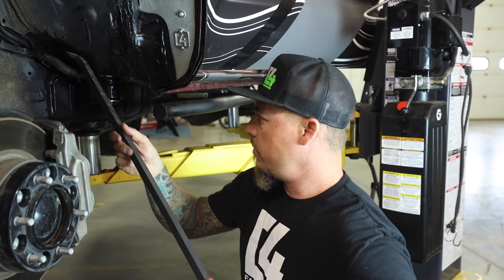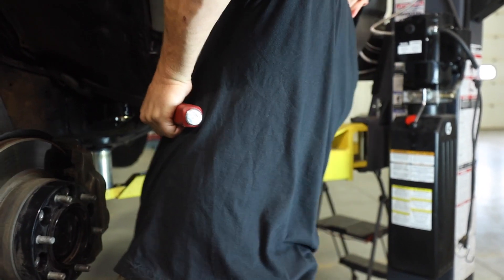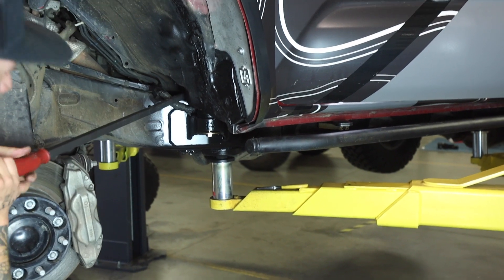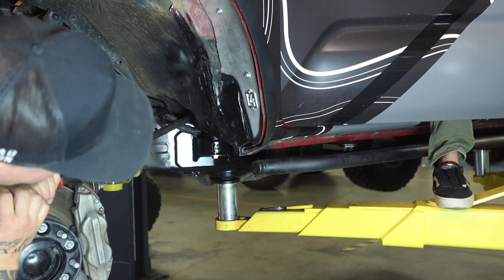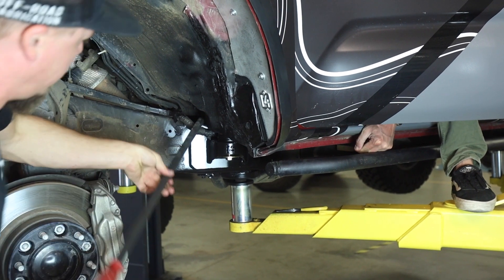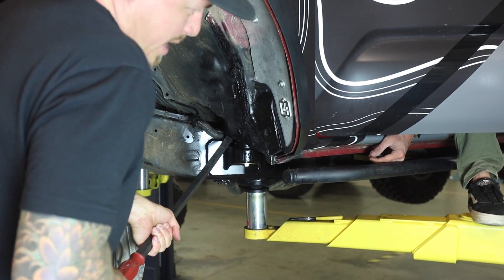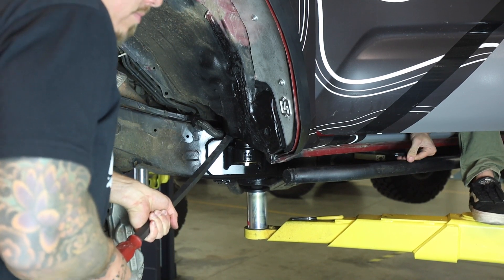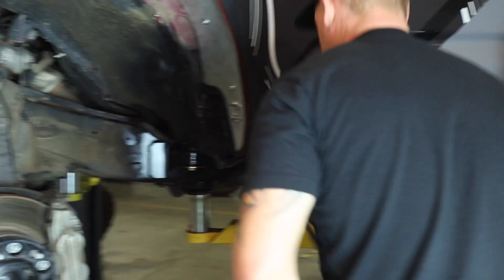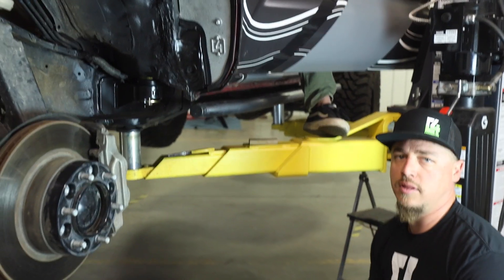If you're having trouble getting the sleeve to push up into the hole, it helps to take the bolt back out from the top — that lets you slide the sleeve all the way up into the mount. Have someone put the bolt back through while you hold the sleeve in place. Once everything is seated, put the other large gold washer on the bottom and then the lock nut. Before tightening anything down, make sure you take out the spacers — or whatever you had set up to hold the body up at the extra height — because if you tighten the bolt first, those will be jammed in. Lift the body and pull the spacers out, then tighten the bolt.